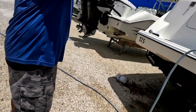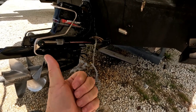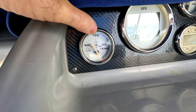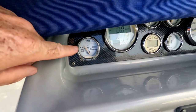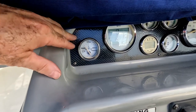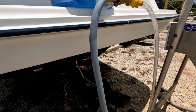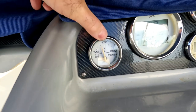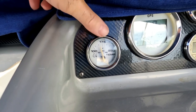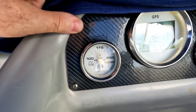One important thing: make sure water is coming out of the exhaust. We're looking for operating temperature between 160 and 175 degrees to make sure the thermostat opens up — this is really important, so check for that. We're checking the temperature again — it's almost there. We'll leave it probably another minute and it should be ready. All right, I think we have operating temperature now, so we're going to dispense the fluid. Stay tuned.